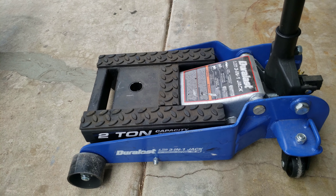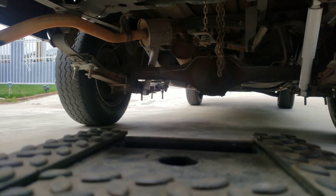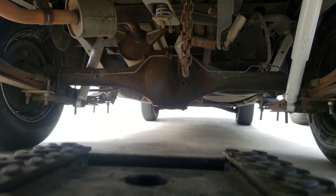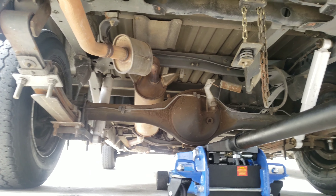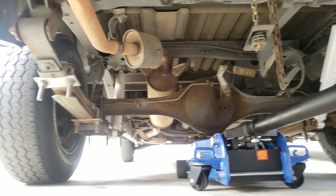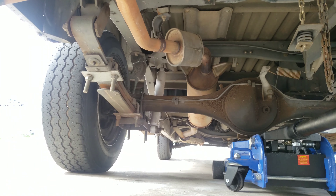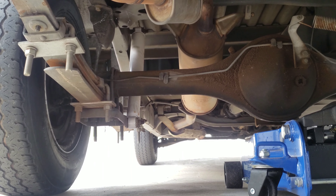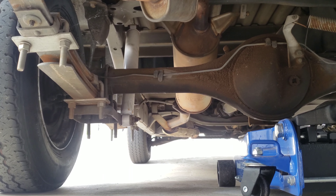See how it's kind of flat there — we'll be using this. It's a bit of an angle. Now you could use the axle part of the differential, but I won't recommend it. You could use one of the other jacks to kind of lift from there, or you could push up from the shock itself as it goes up, then add a jack stand right under it.